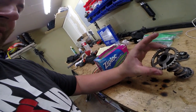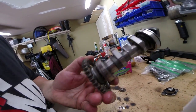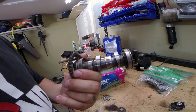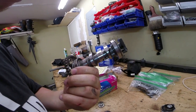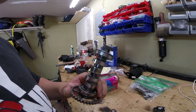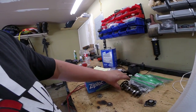Here's the cam and this is what we like to see. There are a few marks here, but the intake lobes look completely brand new — like they've barely even been broken in. The exhaust lobe has a little bit of wear on it but nothing too significant. I don't see anything that even resembles a flat spot or a heat mark. The bearings look to be in good shape, so I would say this cam is in good shape.